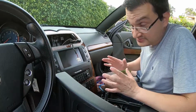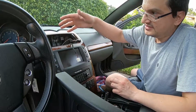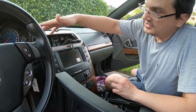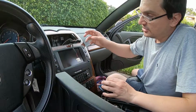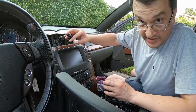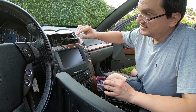All the electrical problems in this car went away, which is absolutely crazy because everything is interconnected. The clock is connected to the navigation, which is connected to the dash, the cluster is connected to God knows what, and now, thank God, everything works. So the lesson here is that from now on, when I'm working on Italian cars, I have to make sure that I mark all the plugs, because they use the same plugs that are next to each other.